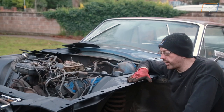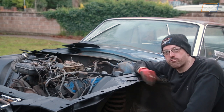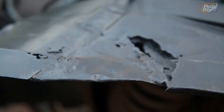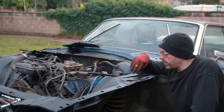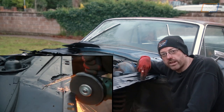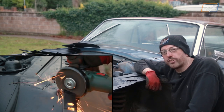While Chris is redoing those calipers, I'm working on this inner wing skin. This was all bondoed up to make it look reasonably good, but when we took it out there were massive holes and you can see the inside has just been kind of clagged together, beaten roughly to shape and then welded in. So I'm going to cut this back, take roughly this triangle out from here, and shape something up that matches the edge of the panel so that when we hang the wing, it'll be a little bit stronger and look an awful lot better.